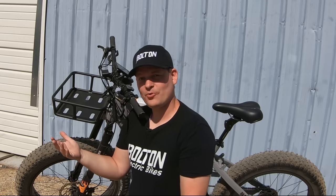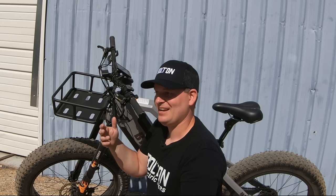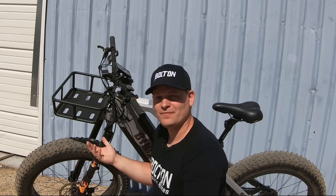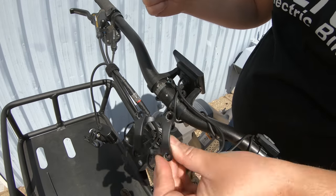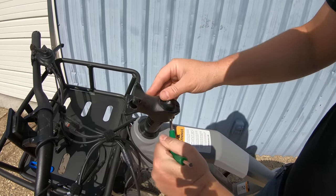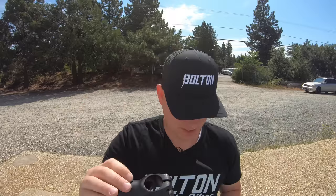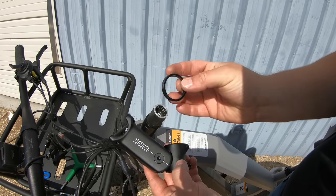Number five: how do you swap or install one of these? I want to put the Red Shift suspension stem on the Warthog. First, loosen and completely remove the four bolts, then remove the face plate so the handlebars come completely off. Give the top bolt a couple of turns on each side until loose, then completely remove the top bolt. When putting your new stem on, pay attention to how thick it is compared to the old one — the Red Shift is a little taller, so we may need to remove one of the spacers. You might also have to add a spacer if your new stem is shorter.